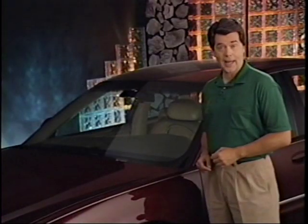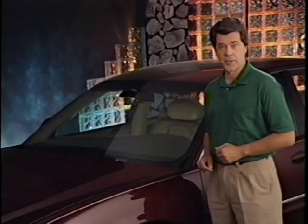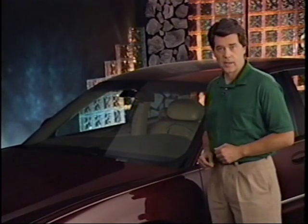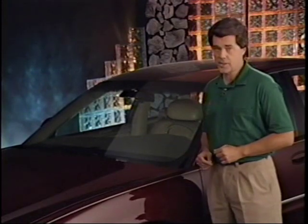With the module on the glass disconnected, it operates as a regular wiper motor to test. Also, if the sensing module fails, the system will revert to delay wiper operation. The system will operate as a standard wiper on the low and high setting. The wiper blades remain in a ready position at the base of the windshield until they are turned off. Also, reduced park force will lessen arm and transmission damage during ice and snow buildup.